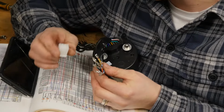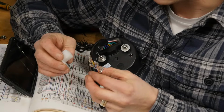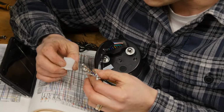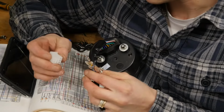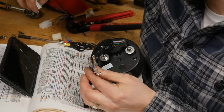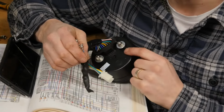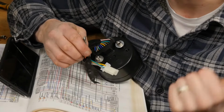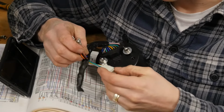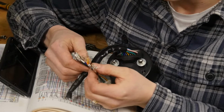So one thing I've done is I've removed the plugs from the block connector, purely because this is a male-sided 9 socket connector, and I don't actually have a female side for that. But also, there's a bunch of these I'm not going to use. This one has a built-in gear indicator in it, but the bike doesn't have a gear indicator, so I've kind of blanked those off, which means I'm able to amalgamate the neutral switch into these. So I now have 10 here.